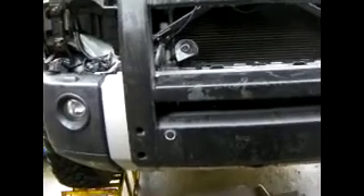I've fixed the bumper back into place temporarily — it's not bolted up but it's clipped into place, and all the holes are ready to line up. I've sat the A-bar in place and measured this distance to make sure the A-bar is in the centre. My brackets are in place and the A-bar is centred. What I'm going to do is drill a pilot hole just big enough to suit the stud — maybe 10 millimetres all around. If the A-bar's in the right place and the bracket's in the right place, the holes should just be a matter of drilling straight through.